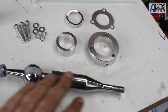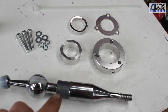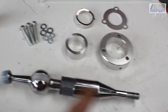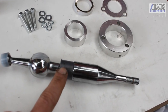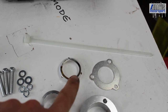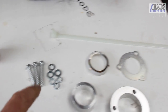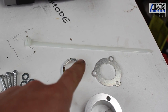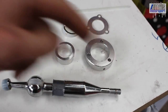Your kit comes with your shifter — usually this is fully assembled with the plastic spacer bushing. I like to use some Loctite between the shifter and the ball end because these two are separate pieces. You've also got your large spacer, your turret spacer, a new plastic ring bushing, the upper cover, three bolts with washers, and a nice big zip tie. I'll go into what those last two are for later. Let me show you how to assemble all of this before we put it in the car.